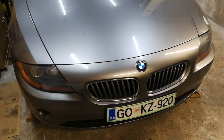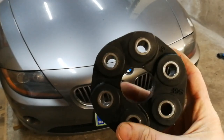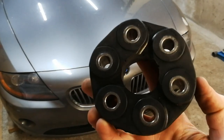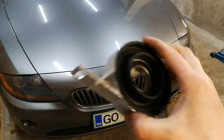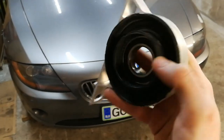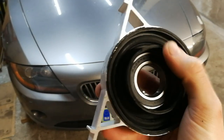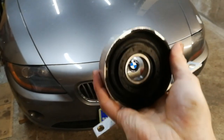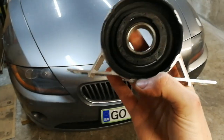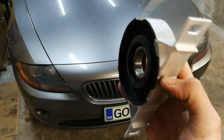I suspect it's the driveshaft central support bearing — they do go bad on BMWs. The flex disc basically connects the transmission with the driveshaft and smooths out jerk or vibrations coming from the engine; it's like a damping device. The central support bearing sits between the front and rear part of the driveshaft, made of a rubber bushing with a bearing inside that flexes slightly and prevents vibrations from entering the cabin.